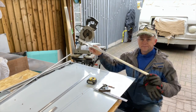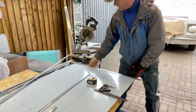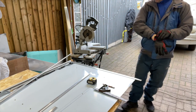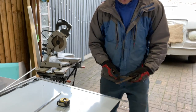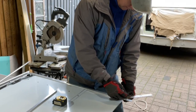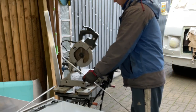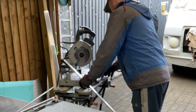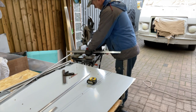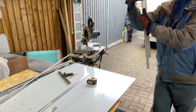Today's little job — we've got some of this beautiful trim. It's really, really nice, just finishes it off nicely. So I'm going to cut it all to shape and size, get it in there, mitre these corners in and it'll just finish that off really nice. And then 45 degrees — that's going to be with that line there. So that's that one in, let's chop that one down. And this saw is amazing — you can bring that round to your 45 degrees. I'll go that side... actually I went the wrong way. So just pack that out with a couple of bits of bar to make it flush, and that'll sit square on the saw now.